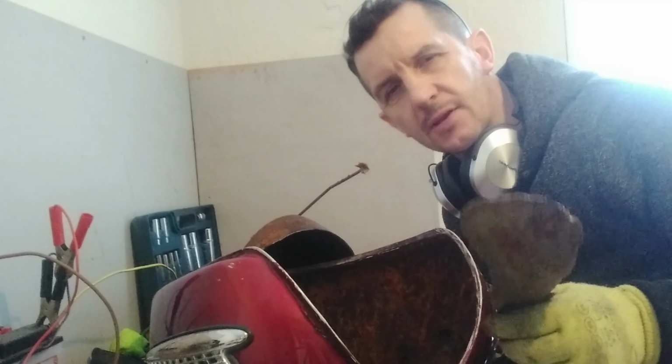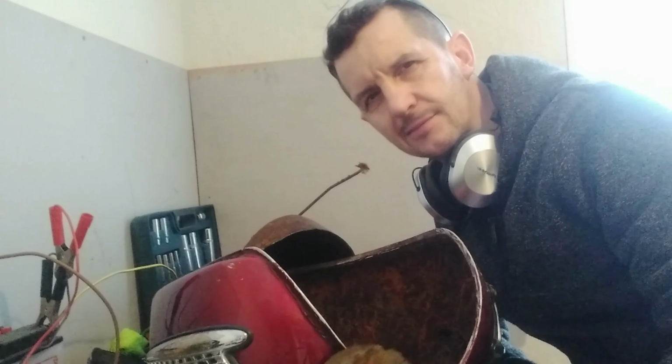Anyway, thanks for tuning in. My next job is to see if I can take it off with a little bit of sandpaper. If not, I'm going to take it to my local shot blasting place. And what about powder coating the inside of the tank? Because tank liners don't seem to work, and paint would come off, wouldn't it? But I'm guessing powder coat might actually work. Powder coat the inside of the tank, then get it welded. Zinced! I get it zinced, I have my Vespa zinced. Good idea. I'm going to stop it corroding, and I'll TIG weld it back together, and then I will respray it, and then she'll be as good as new.